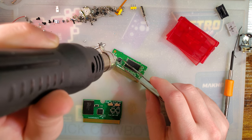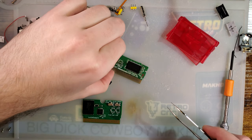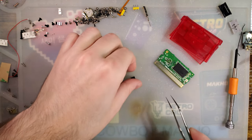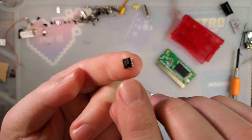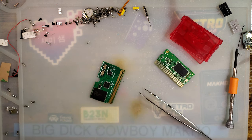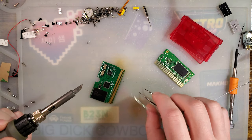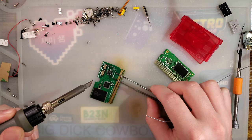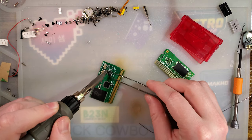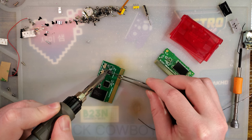Sorry, I'm a little scatterbrained today — been cleaning all day, found this cart I totally forgot about. Once that's off there, I'm just going to solder this thing on by hand. If you take a look at this thing, you see there's a big circle in the casement in the lower right-hand corner. Line that up with the circle on the PCB, drop that in, make sure it's in the 4K slot. And then there is a switch to select which one you want to use. I'm just going to load that up with solder and see if I can hit all four pads at once.